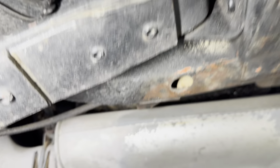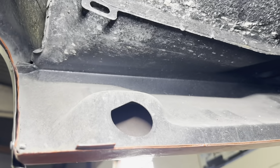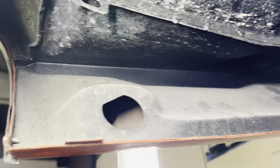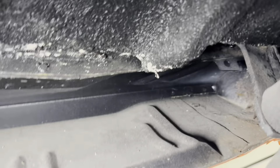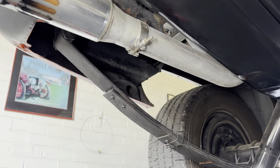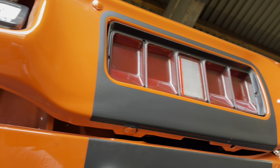Floor panel looks pretty good. Frame rails look pretty good. The big things to look for on Mopars: rocker rust, lower fenders, rear frame rails - especially if it's from the east coast. It's missing the body plugs and the lower extensions - that's kind of a big deal because you'll get water and road dirt in there. You can see a seam where the lower quarters have been replaced - the factory has little tabs that tell you if it's original or not. The gas tank's been painted black, which is amateurish, but the price my dad paid is commensurate with the condition.